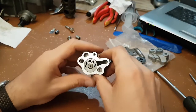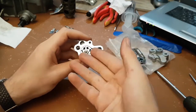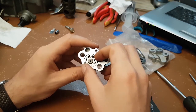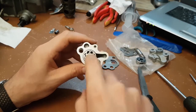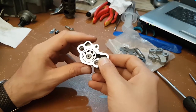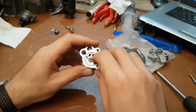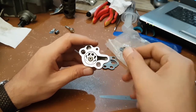I want to speak about oil pumps. This is my old oil pump and I wanted to inspect it. There is a bit of lacking information about these dots, and as far as I understand, you need to align them. The importance of aligning them is which side they are facing. With time, these pumps get scarred from little pieces inside the engine oil.